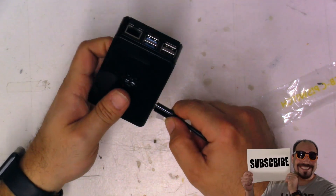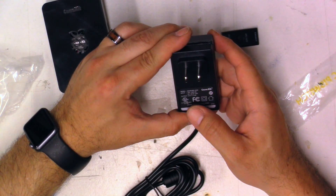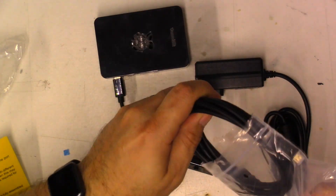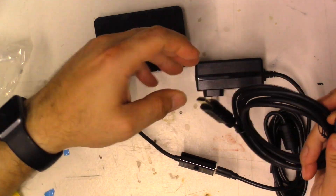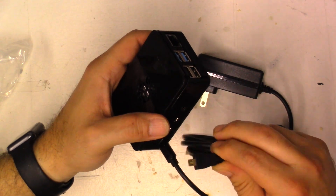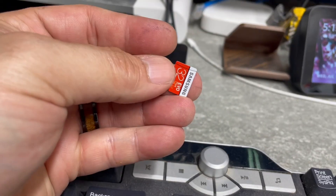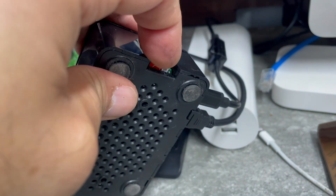This kit comes with a really cool USB Type-C on/off button — connect that right on there. Then get the power cord; I'm in the US so it is a US power brick, output of 5.1 volts with 3.5 amps, USB Type-C, and that goes right in. This is actually a micro HDMI — there's a really small end and then the standard HDMI end. We're going to put it into HDMI zero, which is right next to the power cord — make sure you do that, as it says in the instructions. Then add a keyboard and mouse, and insert the 32-gig EVO SD card in the back.